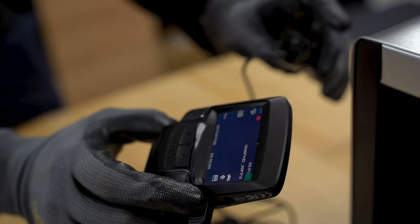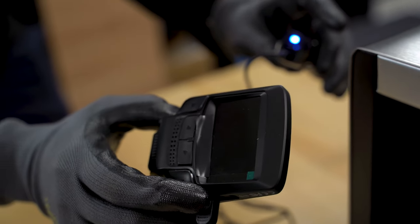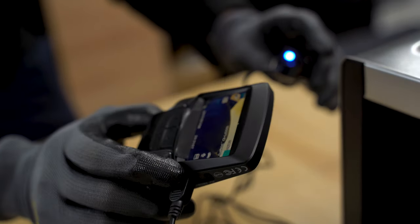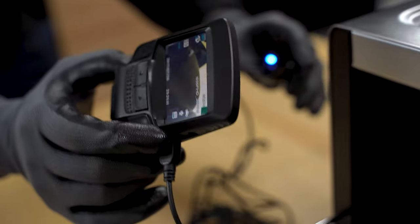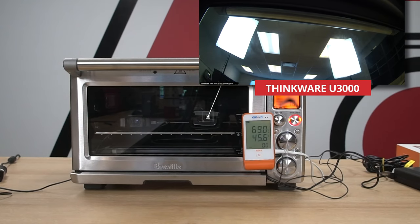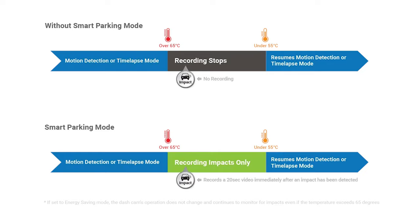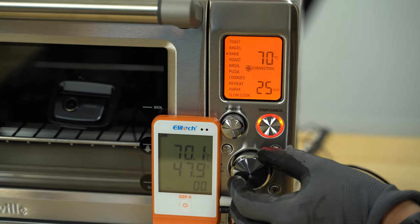Let's give you guys a quick update. We did some investigating on what happened to the basic dash cam. At around the two-and-a-half-hour mark, it looks like it actually overheated. What appears to have happened is that the cigarette lighter adapter was still working fine feeding power to the camera, but the camera itself just stopped drawing power — so that's why it kept restarting. Now, going back to the Thinkware manual, it does say that smart parking mode kicks in between 55 to 65 degrees Celsius. But we're literally at 70.3 degrees and smart parking mode still hasn't kicked in, which is a problem for achieving objective number two. We suspect it may be because the dash cam is only one channel, and perhaps that diagram is specifically for two-channel. So we're going to crank up the heat to 80 degrees Celsius and keep an eye on whether or not smart parking mode actually kicks in.